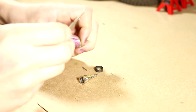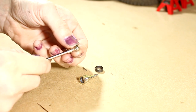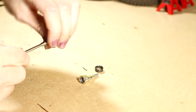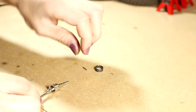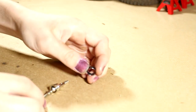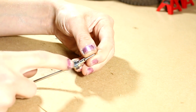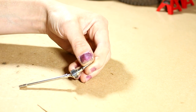When putting the axle shaft together, you take a small cylinder with a hole in it and insert it into the end of the shaft, making sure the hole lines up with the slot. Then put the cup over the top of it, drop the pin in through the hole in that little piece, and take the retainer collar to keep the pin in place. You can put a little dab of grease inside so the collar doesn't fall off while you're working, or just go ahead and press the bearing onto the end.